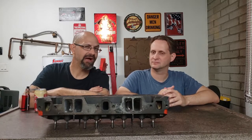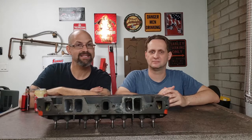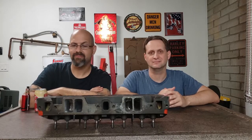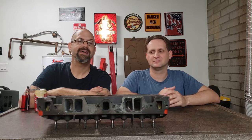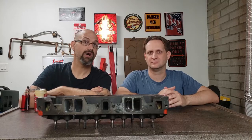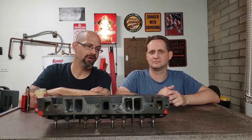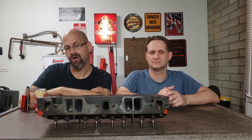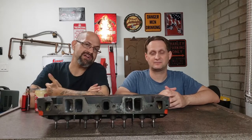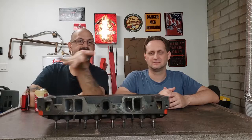I got into the valve seats a couple times last week when I was port and polishing the intake valve. Do not do that. I even made the mistake of telling you guys it was an okay thing because I'm having them change to bigger ones. That is also not correct. Once you get into them, you have now also altered the shape of the metal underneath, and therefore it trashes your heads. Plain and simple, I ruined a perfectly good set of heads.